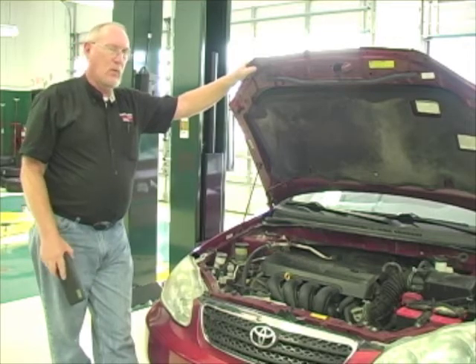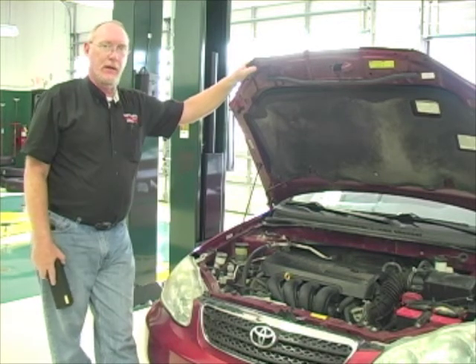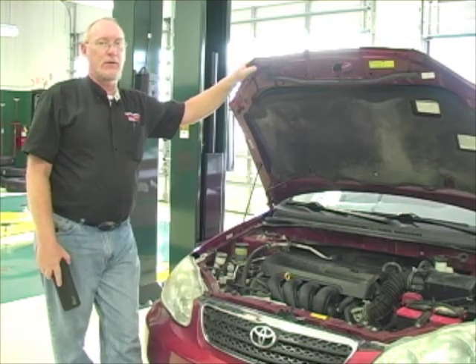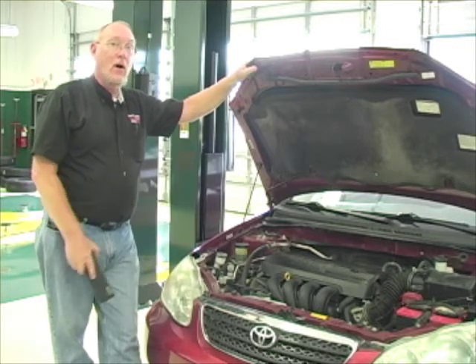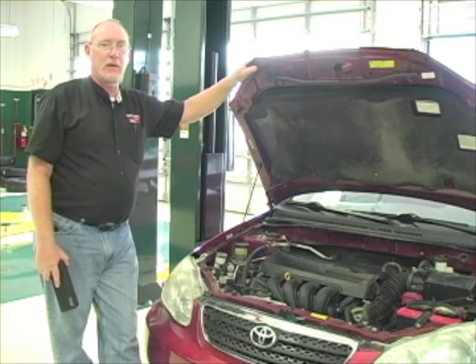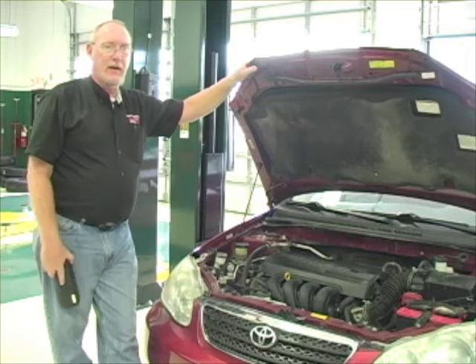Now that we've determined why the coolant has such a high alkaline content, we know we're going to have to recommend the flush and fill — we don't really care how long the coolant has been in there. If we did uncover an electrolysis problem, or a combustion gas leakage, or maybe the wrong water source was used, all of these are factors that are going to contribute to the wear and tear on the passageways and the components. And that's not good for your customer's pocketbook. So we're going to go ahead and recommend a full flush and service on this particular car for that alkalinity.